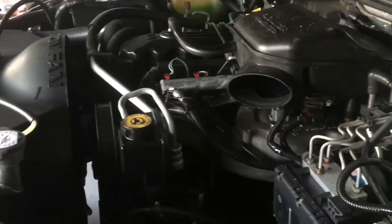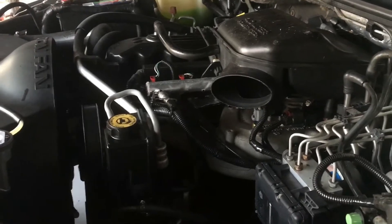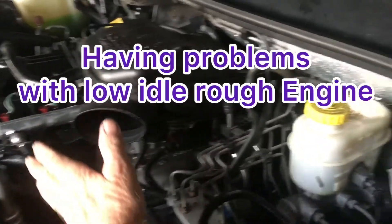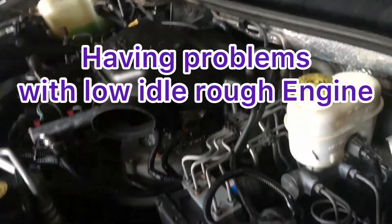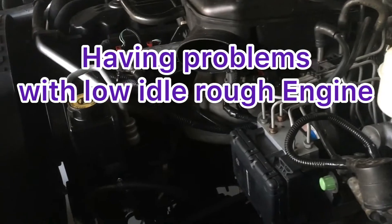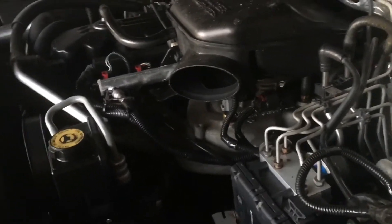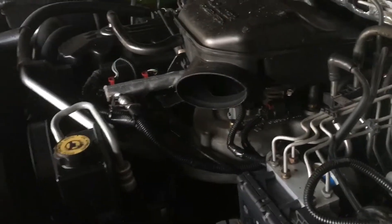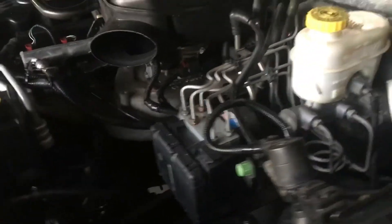The first start of the day when it's cold — when it starts up, there's a loud swooshing noise and it's sucking a lot of air right here. After probably less than a minute, with the engine running a little rough, it smooths out, the noise goes away, and it's running pretty smooth. It does that every time when it's cold.